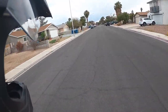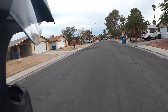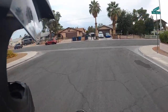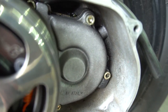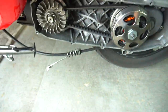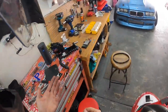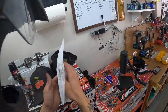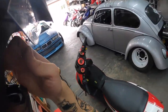It's got the good launch now - you see that? It doesn't feel like it has any more to it. I still have that Sharpie mark on the variator, so we're going to see where it's hitting right now. Either up the rollers or change the belts now. Given that there's already pieces of rubber all inside this motor when this thing was spotless when I swapped belts, and seeing this mark on the variator, looks like the belt was slipping there. I'm going to go ahead and swap back to the other belt and up the rollers a little bit, then try it again. Changed back to the OEM belt because I feel like that's when it was happiest when we first were messing with it. Kind of get a better idea now with the new clutch setup and everything. We're jumping around a lot, but we keep adding parts and taking away things.